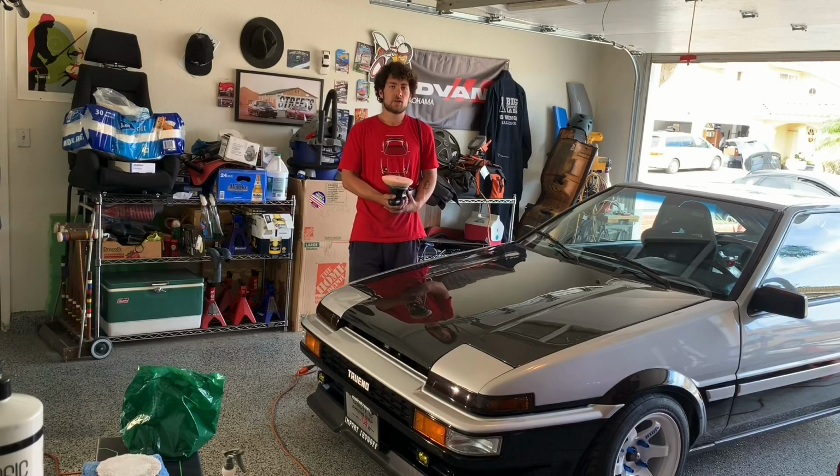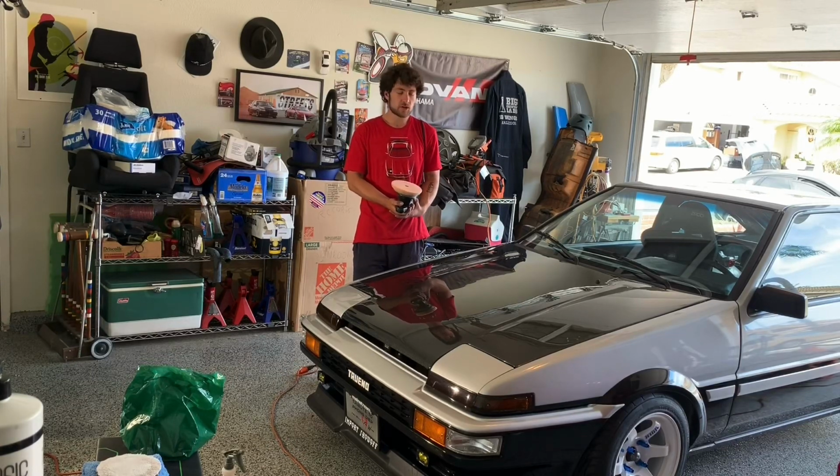Now there are times where you're going to do this and you're going to look under a light and you're going to be like, oh my God, it didn't do anything. What the hell did I do wrong? Well, you might've been too aggressive during your first step. Sometimes when you're too aggressive with a compound, or you're using a wool pad or something, you create tick marks in the paint. And although your customer 100% of the time is never going to see them, they can be very difficult to remove.